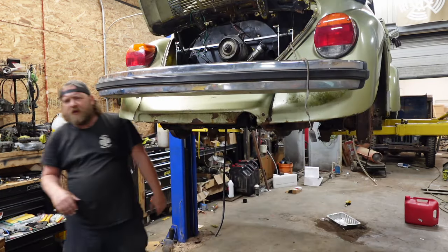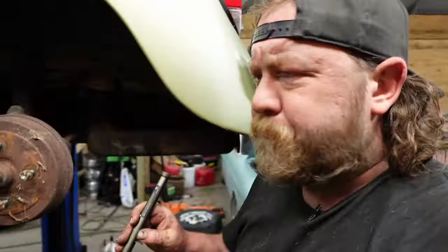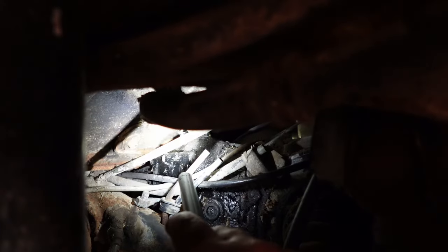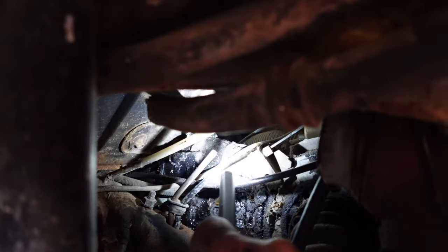It's attaching fuel line, so I'm not really gonna show much, but if you were doing a fuelie conversion, you have two lines. I don't know if you can even see because the screen's facing the wrong way. You have these two lines that come out. The bottom one, that's return. Top one, out. So you wanna connect to the out, to the engine, and then you just cap that one.